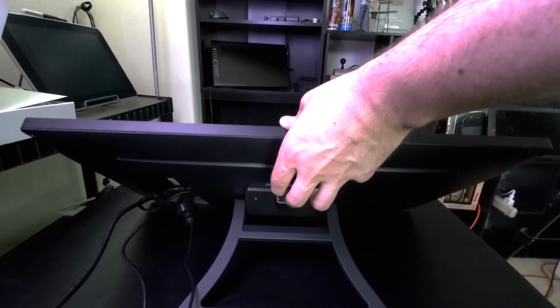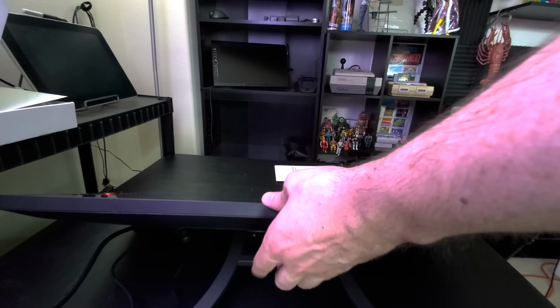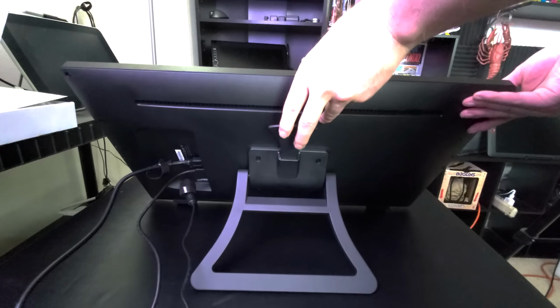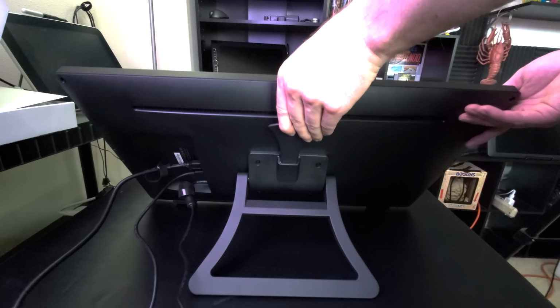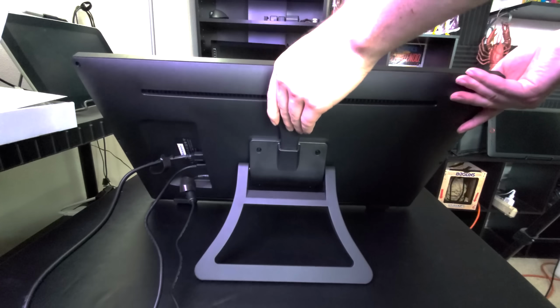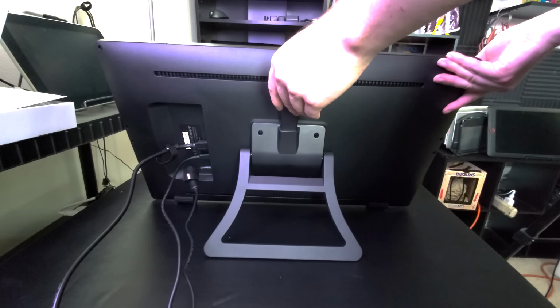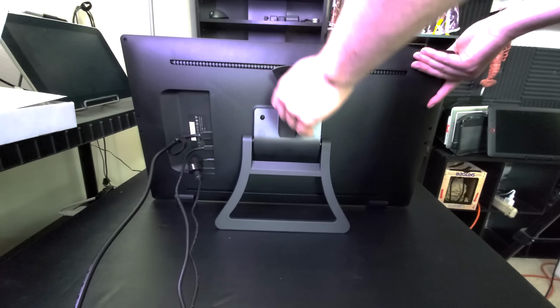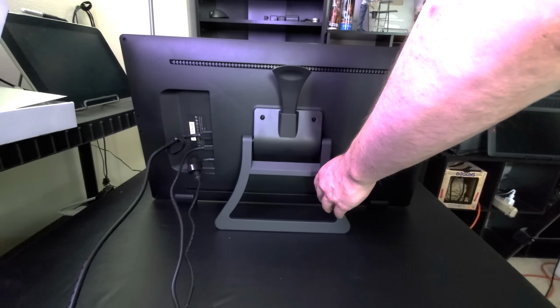It's definitely an improvement from the old stand designs found on budget display tablets like this. If you keep the tablet in a fixed position, the stand works well, but not when you try to adjust the angle. For starters, the locking mechanism doesn't catch the tablet as securely as I'd like it to, and the adjustment angle intervals are a little jumpy as well.